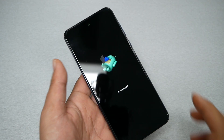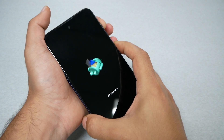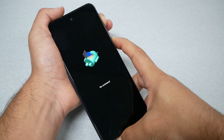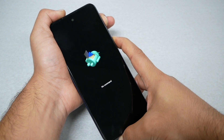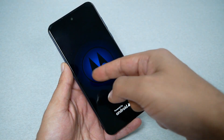We're going to try to make a restart. The best thing to do is press Volume Up and the Power key together at the same time, and hold both keys until the phone restarts or turns off. So I'm pressing Volume Up and Power at the same time. No matter what type of frozen screen you have, it should restart. You can remove your finger once you see the Motorola logo appear on the screen.